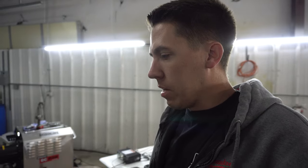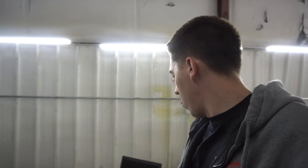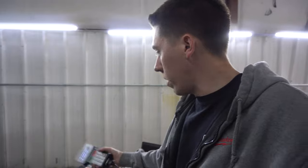After doing the idle, I need to start doing some steady state style tuning where I'm stepping up in the cells on the mass airflow. I'm having a few issues with the computer and the key for the software not working. I think the computer didn't update and now it's mad. So I'm going to start doing some of the steady state tuning going cell to cell on the mass airflow — I'm just going to use the handheld with the box.